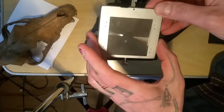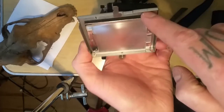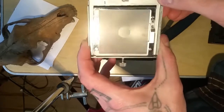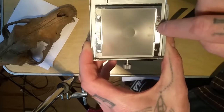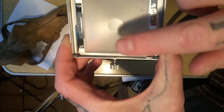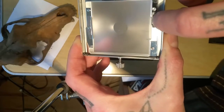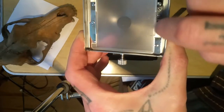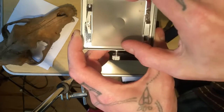That's going to give you access to this area, and it's also going to help you get to the parts on the underside. This looks very good — I've put in new light seals in here. There are these two tabs right here. Once you unscrew this screw right here, you'll see a slot in it. This little tab just kind of pushes out and that releases this tab of the Fresnel, freeing that part up. Then this one — once you unscrew this screw — you'll be able to just pop it up.